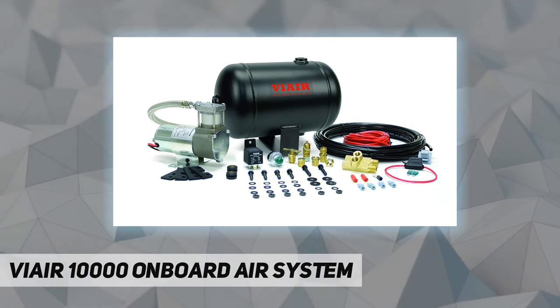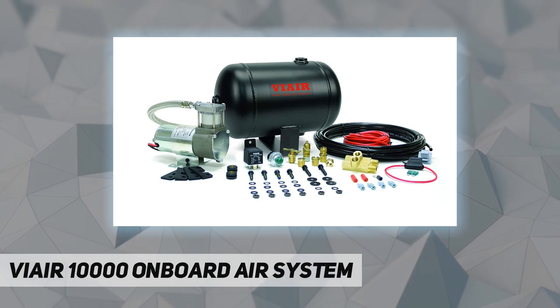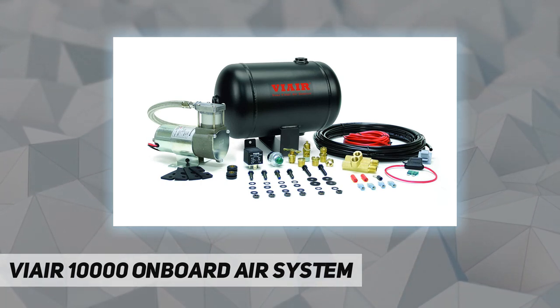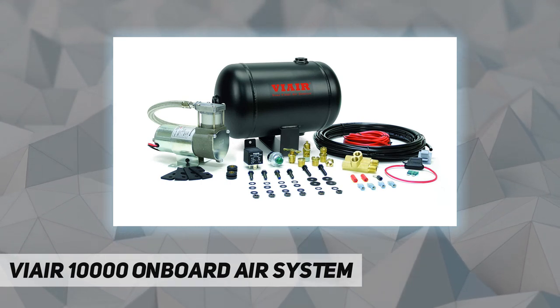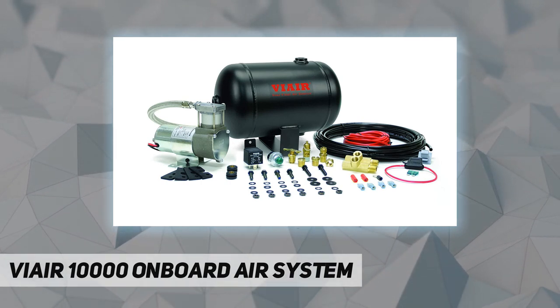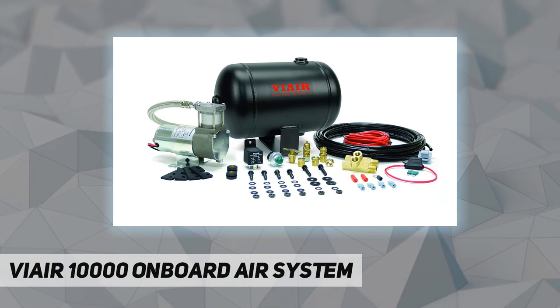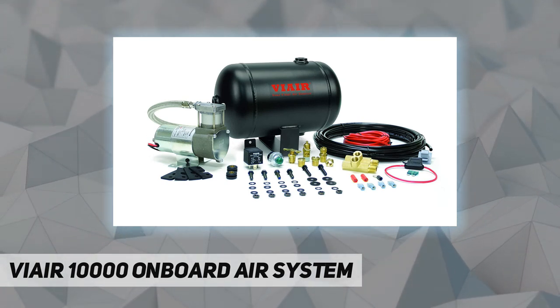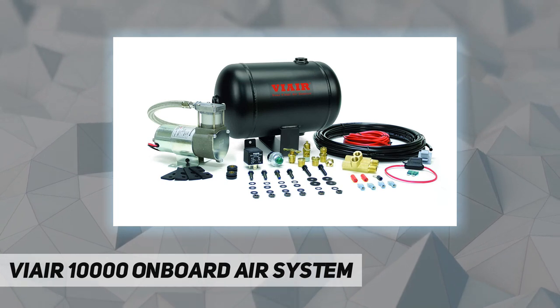The ultra light duty on-board air system includes a 40-amp relay, properly sealed. Recommended torque for 1/8" fittings is 10–11 foot-pounds. Recommended torque for 1/4" and 3/8" fittings is 12–15 foot-pounds. T-fitting: 1/4 x 1/4 x 1/8.